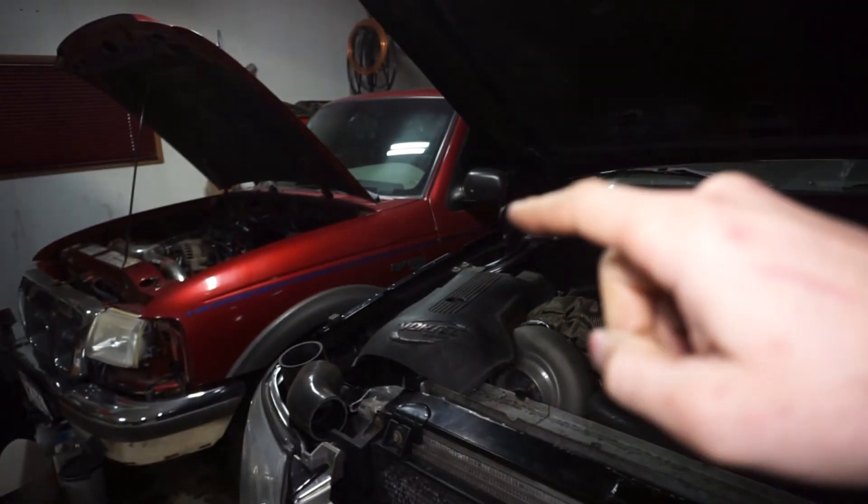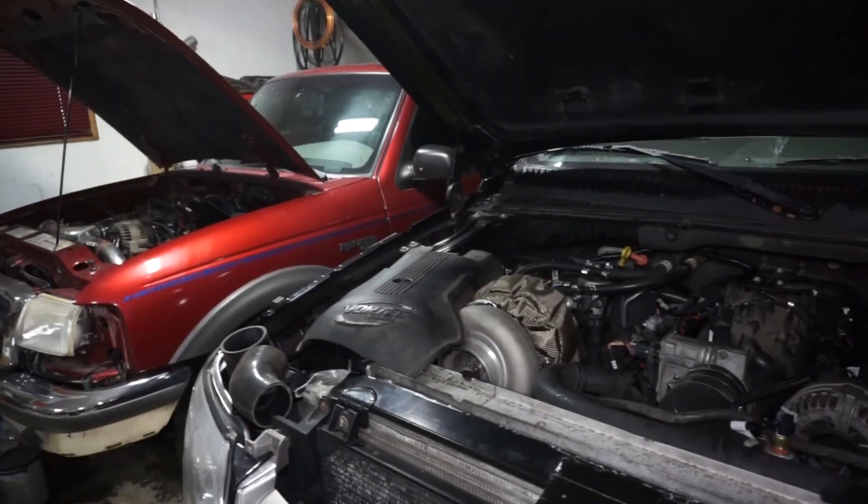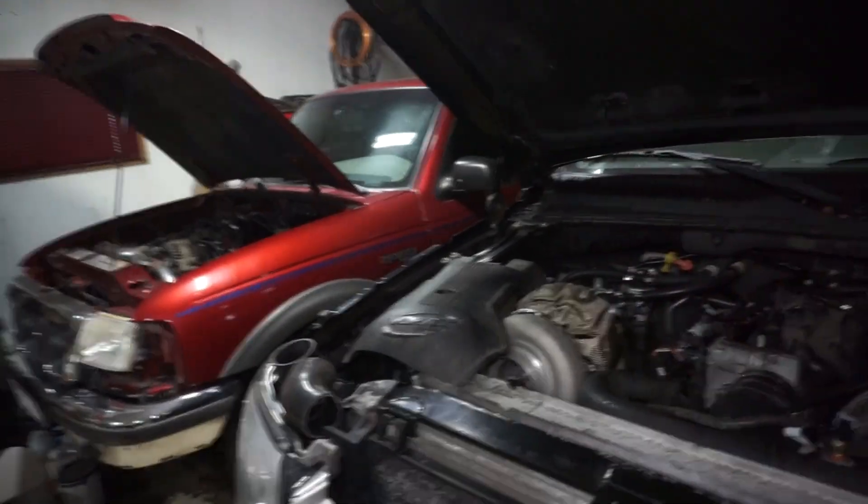I have a couple of big relays that I've had in the shell for a while — these 120 amp big boy relays. I have two of them that I've been sitting on for about a year, never used. The relay is really excessive because for the additional two pumps I only need about 30 amps of draw, and I know that because I measured it on the Ranger. With the two pumps on the Ranger I measured about 30 to 33 amps and I'm running a single 40 amp relay in there.